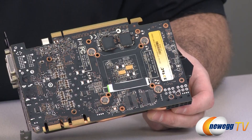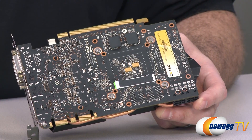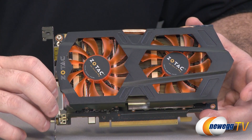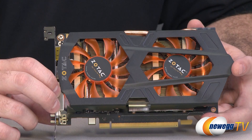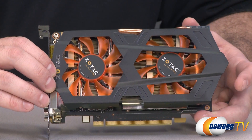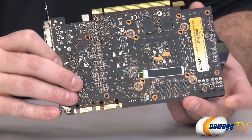The GPU itself is located right below those two yellow transistors. Beneath that is the GK104 GPU, which is the same GPU used in the GTX 670. It gives you access to all those features like TXAA and FXAA. The GPU also has a nice allotment of CUDA cores — 1344 — same as the GTX 670. Core clock on this is 915 MHz, boost clock is 980 MHz, and generally your boost clock can even go beyond what's listed on the box. You get two gigabytes of GDDR5 memory, 6.0 gigabits per second data rate, on a 192-bit memory interface.